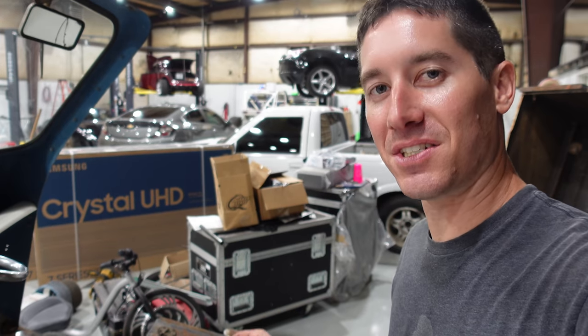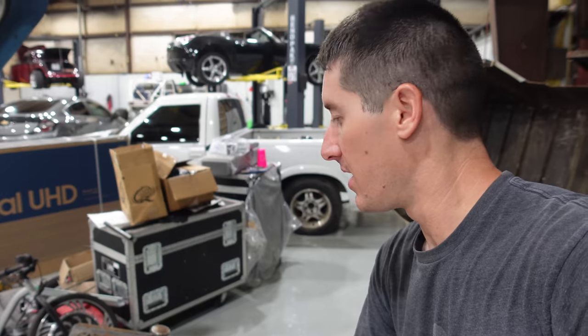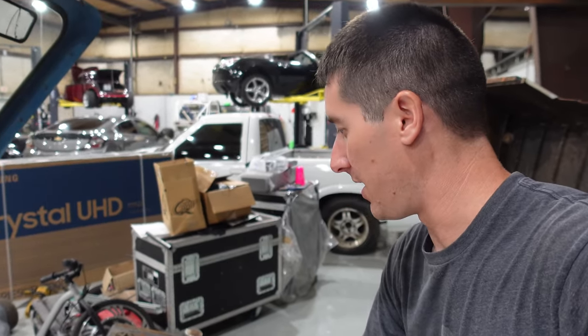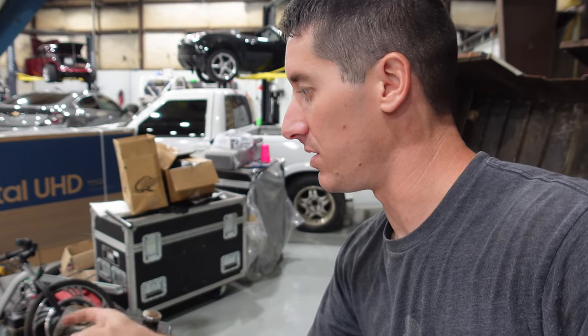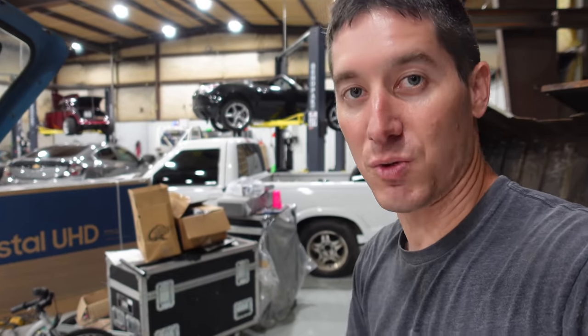I have cleaned and cleaned and cleaned the tank. I ran a bunch of fresh gas through it, sloshed it all around trying to get all the old varnished gas out. So now I need to grab some two-stroke oil — back to O'Reilly's — and a gallon of gas or so. We'll use that mixing cup to mix up our two-stroke mixture. Hopefully we can get some fuel into this carburetor and the thing starts running for real. I'm going to put the ignition switch back, which was actually fine — it does power the coil off its own terminal, and whenever the ignition switch is on, the coil is always powered, which is probably why they pulled the fuel gauge power from that as well. We found more horrible wires that just fell apart, but now that those are replaced, we're good to go.